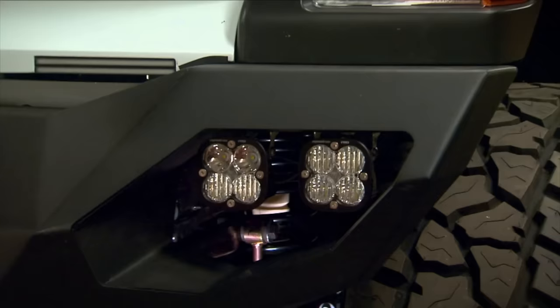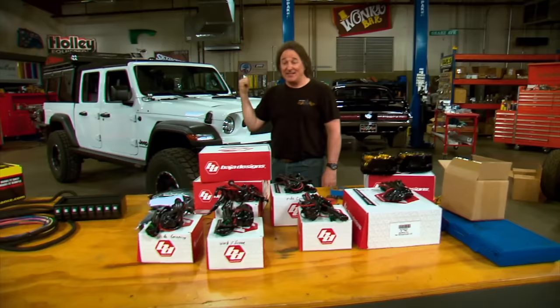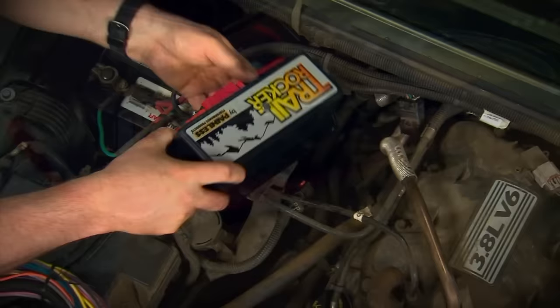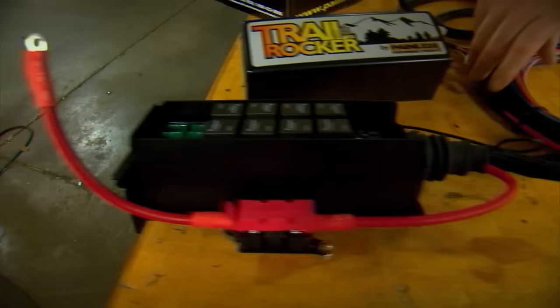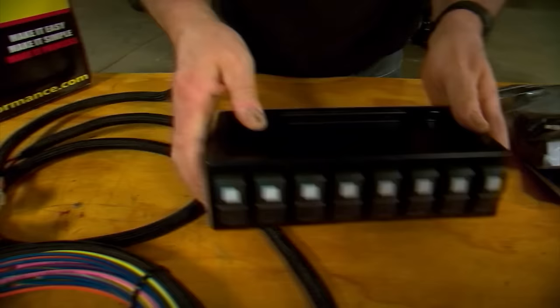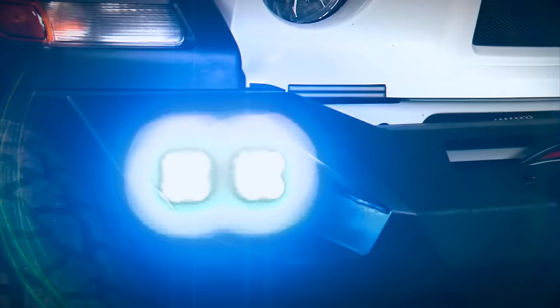We have lights all around this thing, each one serving a specific purpose, and most are tucked into the bumper and rack to protect them off-road. You can get all these lights with their own wiring harnesses — switches, fuses, relays, everything you need. But with seven sets of lights, seven hookups to the battery can get pretty messy under the hood. So we're going to use the Trail Rocker by Painless — a box that includes all your relays and fuses in one neat location, one hookup to the battery, a wiring harness to individual lights, and a switch bank that controls all your lights. We have eight lighted switches for eight different accessories. This is a great way to consolidate a lot of accessories.